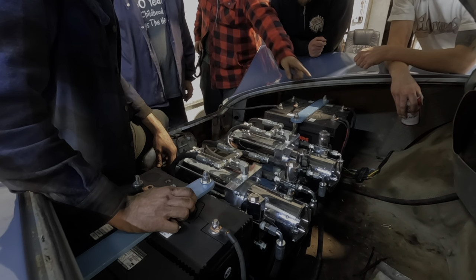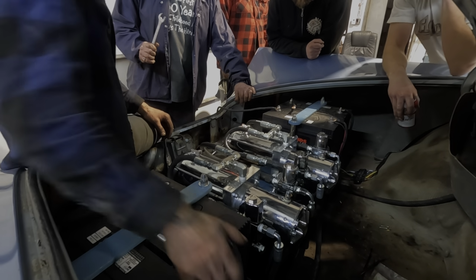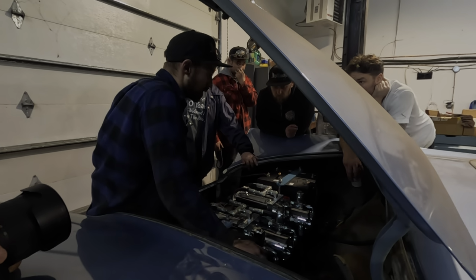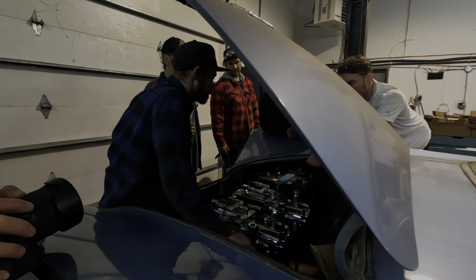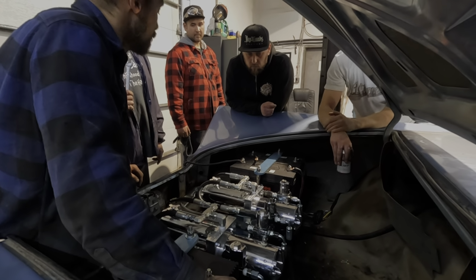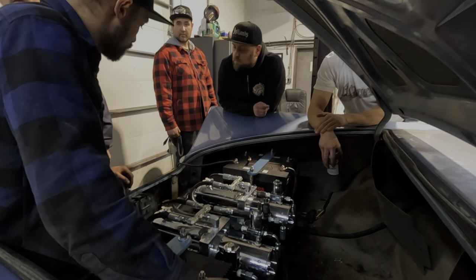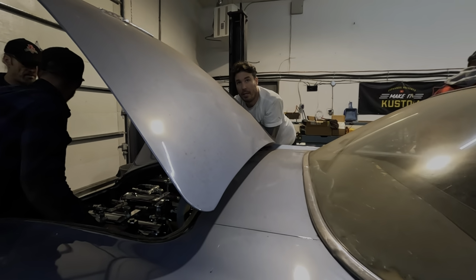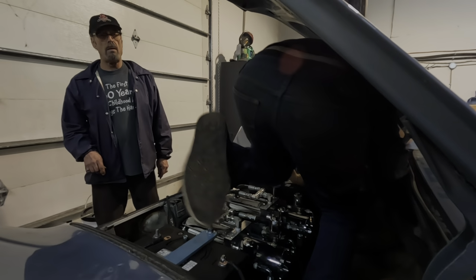We need to keep this 12 volts live for the switches too. I know that. Okay, so we're not going to reach. So we can relax then. This can stay at 24 volts, right? So we can just hook everything back up and just run the ground. You're just trying not to bleed on 24? Yeah, because there's nothing in the pump head. It'll spin the pump head too fast. It could eat the gears up without having any fluid in there.